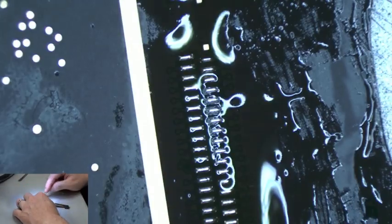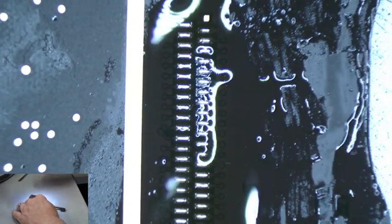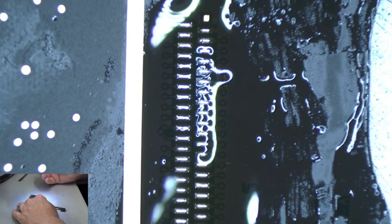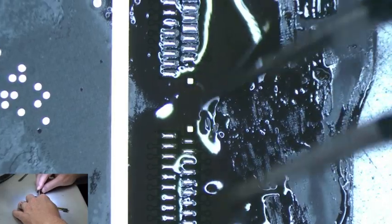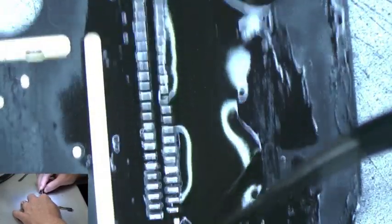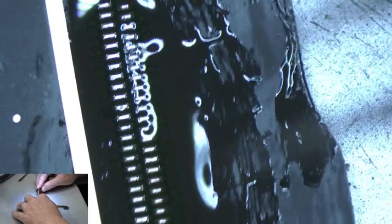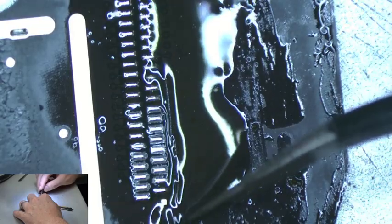And it's okay to leave this solder on these pads here, because when we put the new display on, we're going to lay it flat on top of this board, and I'll show you how the new cable is designed. There's little holes in each pad so that the solder will flow through onto the cable. And just a little tip here, you see these square pads on each side of the connector. You don't want to get solder on those. If you do, it's okay. It's just a ground pad. But I'll show you what they're useful for here in just a moment. And it's best if you don't have solder on them to be able to use them correctly.